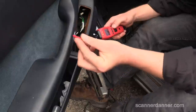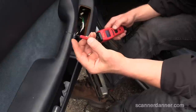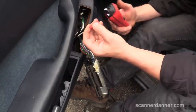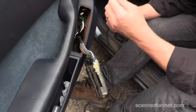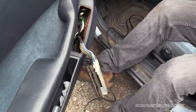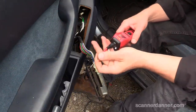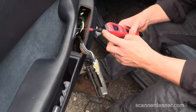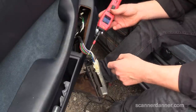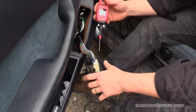I'm using a Pico back-probing lead — I forget what they call these, acupuncture leads. I'll put a link in this video for where to get these — these are my favorite tools. It attaches to my power probe with an adapter that I got with a power probe accessory kit. I'm using the power probe because I may have to energize this motor manually, and this would be the tool to do it with.